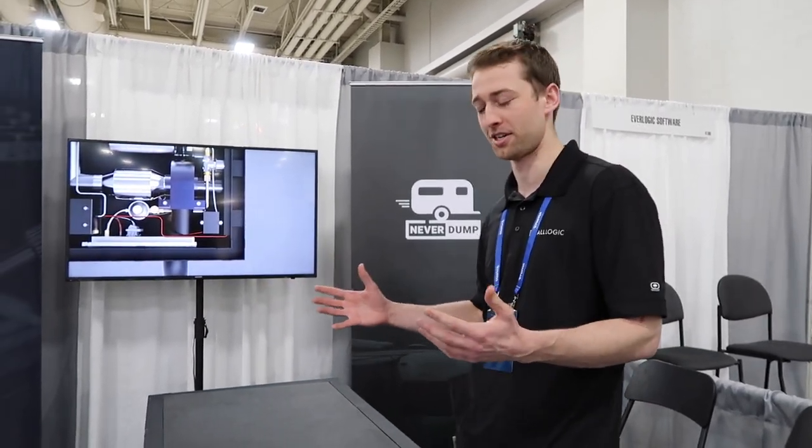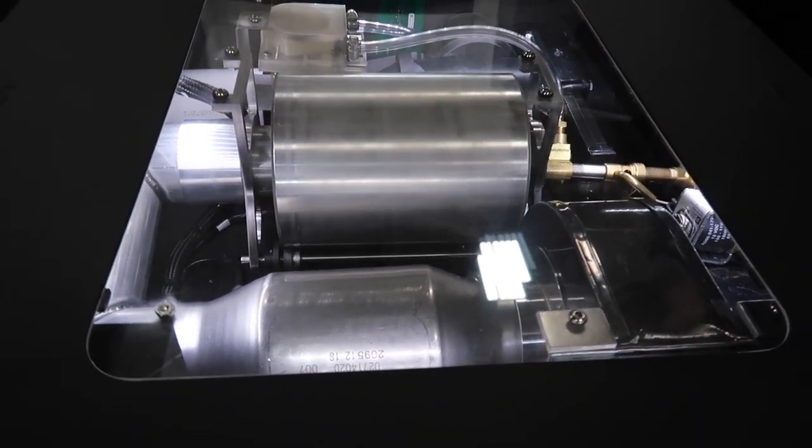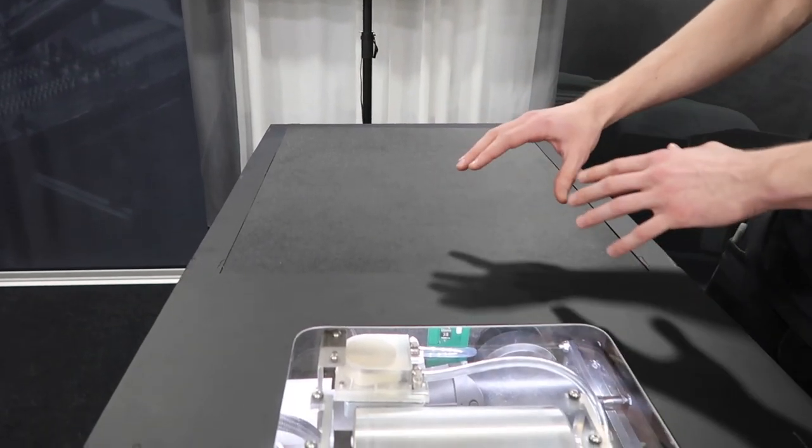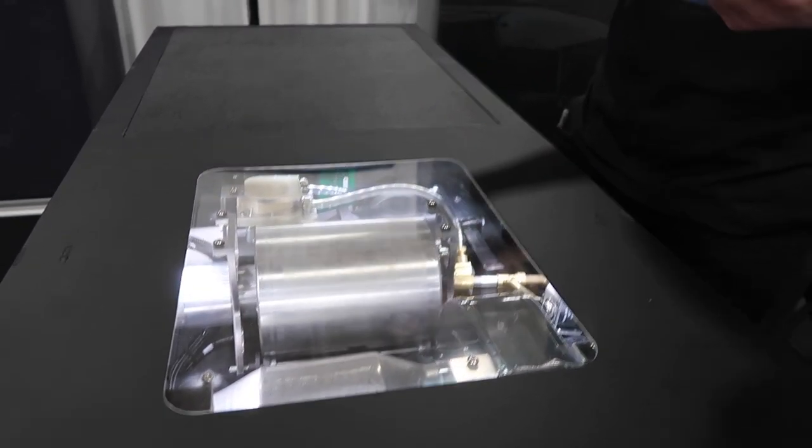This is called Never Dump. It's made to be a black water tank replacement — where normally you've got a regular ABS black tank that fills up with all your sewer water and you have to dump it out later, which is everyone's least favorite part of a trip. We've developed a black water tank drop-in where it collects that same sewage, grinds it up, recirculates it, and shoots it into a tumbling kiln powered by propane to burn everything up. All the water is evaporated as steam and let out, everything else is completely broken down, and it's treated by a catalytic converter — so we're just left with carbon dioxide and water vapor exhausted out. There's no dumping at all, and there shouldn't be any maintenance needed.